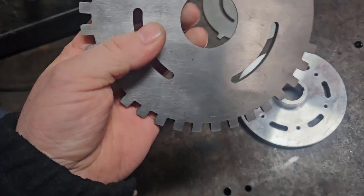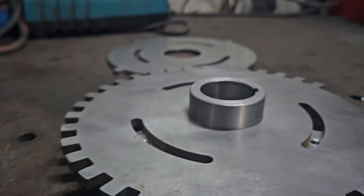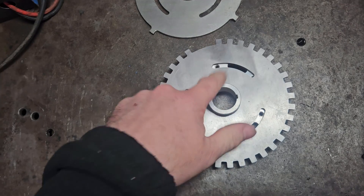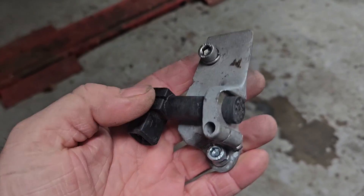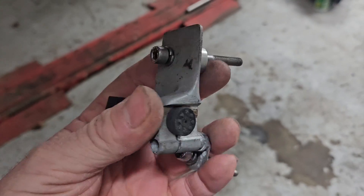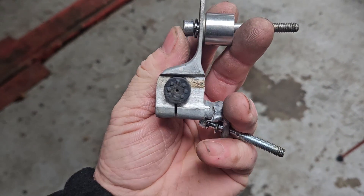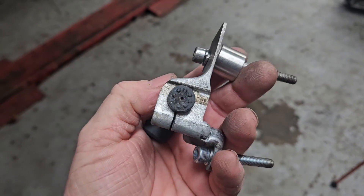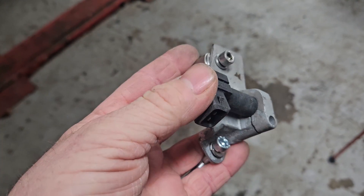There we go. I've managed to put a chamfer on it and run a bit of emery cloth round there, so now it fits on there nice and flat. We can set this roughly up to 60 degrees before TDC and then bolt it in and back on the car. This is the CPS bracket — I've had to modify it very slightly and I'm going to have to put a spacer here, because this is a ZVH and the oil pump setup is different to the CVH, so we just have to move this around slightly to make it fit. This is just a normal VR sensor. We'll gap this to about a millimetre once we've got the timing wheel back in and we should be gold.